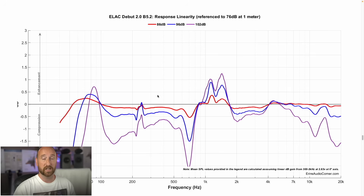This speaker does not handle compression very well, and that's kind of the other problem. While the distortion is relatively low-ish, the compression is rather high as you get to high volume. There are some things going on there — I wonder if that might be crossover components heating up or some kind of non-linearity in the crossover. At the highest output volume you're losing about 1.5 dB in the mid-range; at more moderate volumes it's within about half a dB or so.